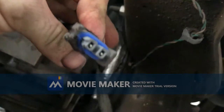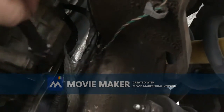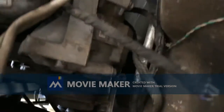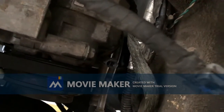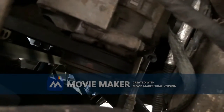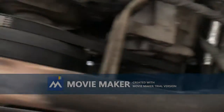It's got good ground but no power. It's got 13 volts but it's like a fake reading because it's not quite making it through the fuse panel. I powered it up with my power probe and the clutch engages, but it doesn't do it with the actual vehicle wiring. So I gotta figure it out.